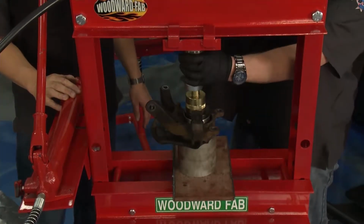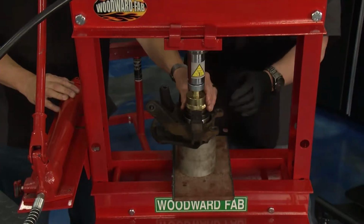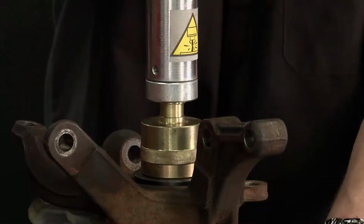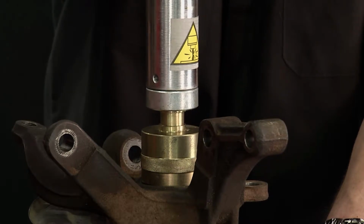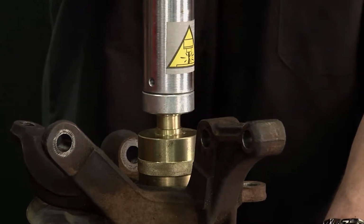We put the clip back in, put it on the other side, and the way we took it out, we just reversed the procedure. We went ahead and pressed it in, and we were watching it. Once it started to get tight in the gauge, we knew we were seated there, and we put the other clip in. Chase, it's a matter now of just putting that hub in.